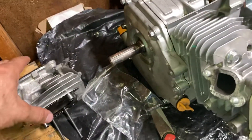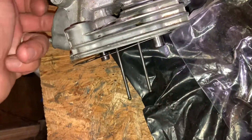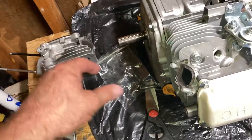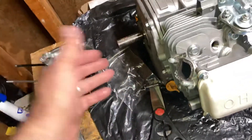So that's what we're going to do. I'm also thinking about doing a little port and polishing — I'm going to port and polish the head a little bit. Yeah, that's pretty much it: we're going to do a non-hemi head on a hemi block with a flat top piston to gain some more compression.